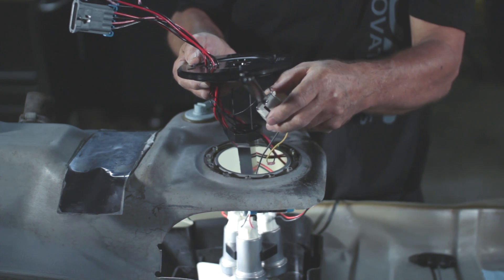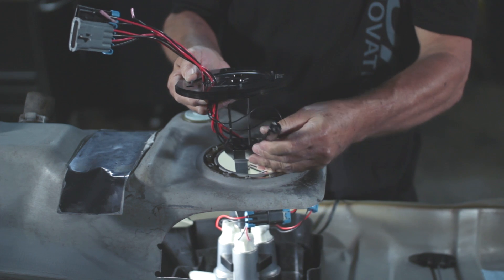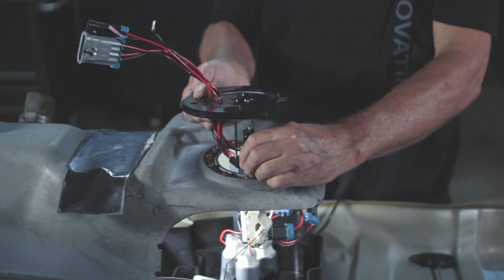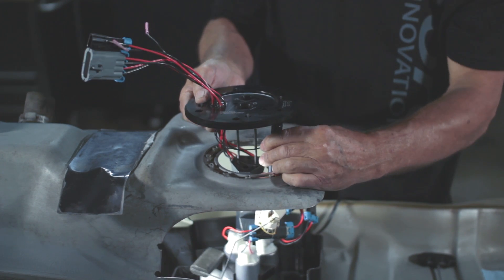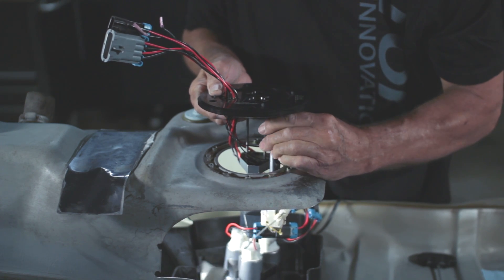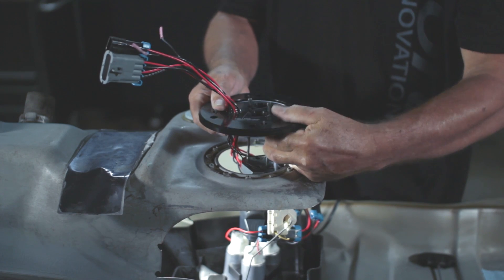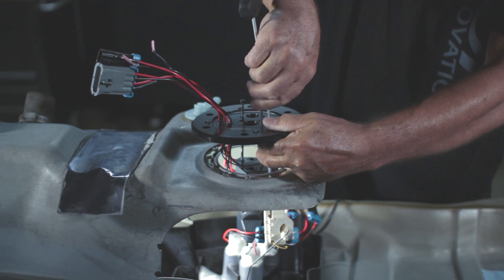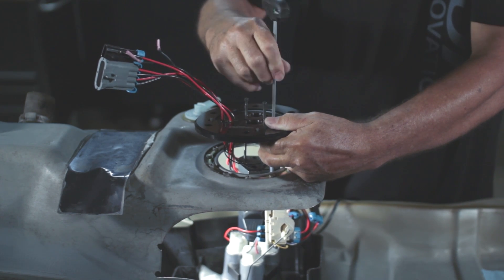Having it lifted up like this, just feed the level sending unit in very carefully. Slide the level sending unit in, making sure you are clear of the wires and keeping the orientation right. We know where it bolts in — slide the level sending unit in there, the arm for it slides into place, then just grab your screw and put it in there. Of course, verify the O-ring is still on that level sending rod.